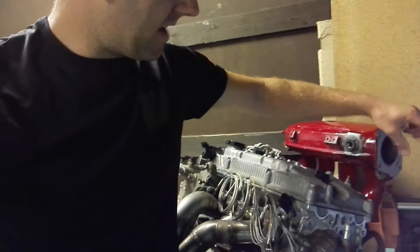I'm going to be running water injection on this engine anyway. I was going to run it on the intake pipe which runs around here, and I was going to have a fitting — probably an Aquamist or something like that, just a nozzle. I've got a pump which I've already purchased and pressure regulation sorted — I didn't think any of this factory stuff would work.